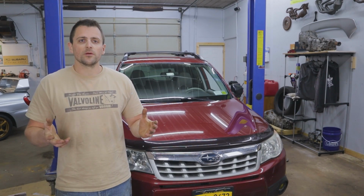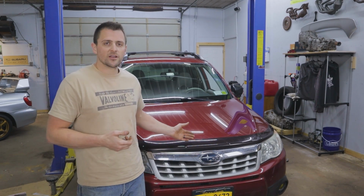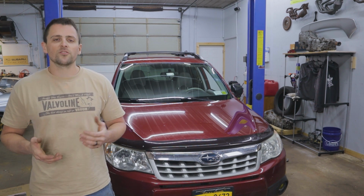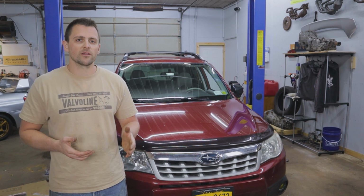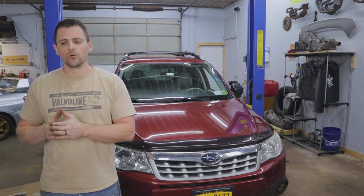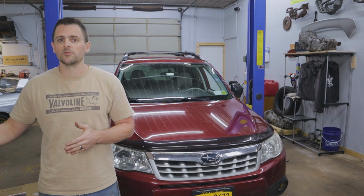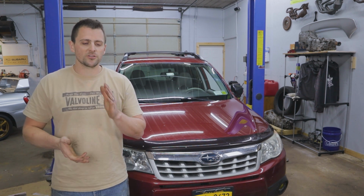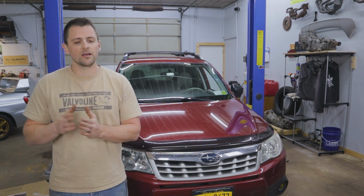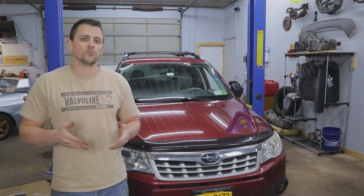So that's everything all wrapped up, guys. It's honestly a really easy project. It ended up being a little time consuming and frustrating on my end, but that's my own fault. I didn't double check and recheck wiring to know what was hot compared to the wire coloring of the pigtails that I was using, and I ended up blowing that fuse. So if you're doing this, just make sure to check and recheck, know what wires are hot and what wires are not hot to avoid that problem.